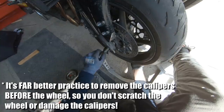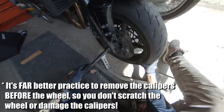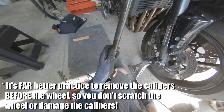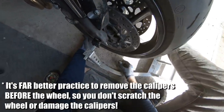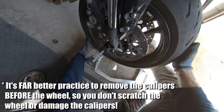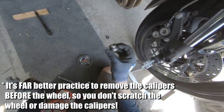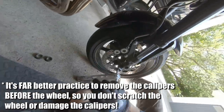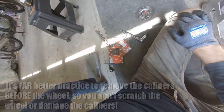The chain's going to pull that out and the wheel's going to want to drop to the floor. There we go — here's the axle bolt. One of the spacers — we're definitely going to have to clean that now because it's covered in grit. There's the other spacer, also covered in grit and slime. Obviously the wheel doesn't want to go any further because the calipers are stopping it. There's no way this wheel is coming out without the calipers getting out of the way — they have quite literally put the brakes on our progress.